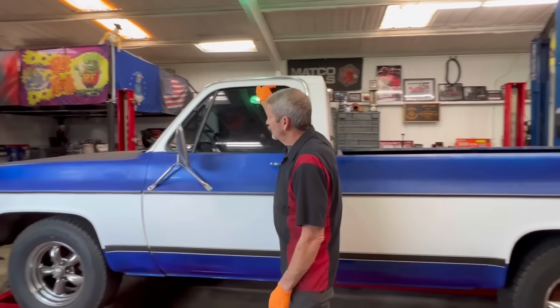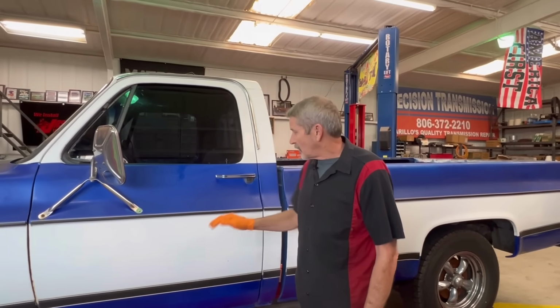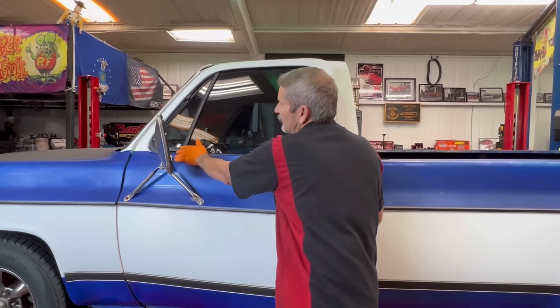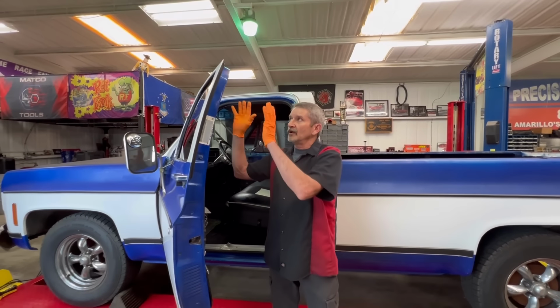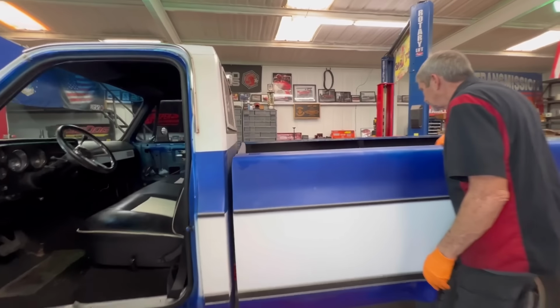What I decided to do for Marlon was help him out on changing all of his door molding, window molding, the mechanism inside, the electric motor, all the trough felt, everything like that. I did both doors. This door was about 2 days to do, to take the window out, change all the felt, the molding, take the wing window out, change all the rubber around it. Because on that type of stuff, you physically have to drill the rivets out, take the assembly totally apart, put the rubber in, pop rivet all the framing back together, put the window in, and then get all your felt, your electric motor. You can see here, Teresa, if you want to show them what I did.